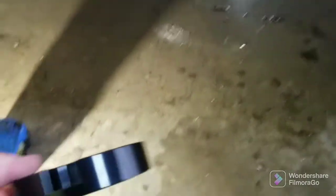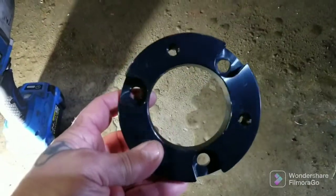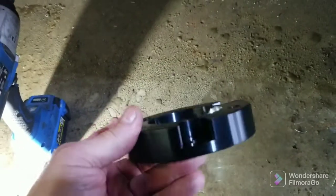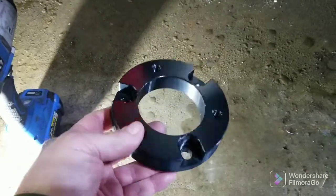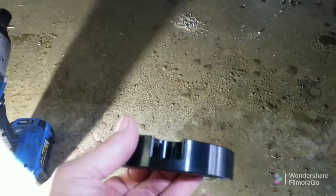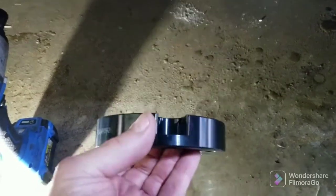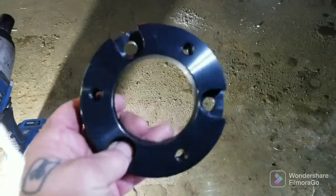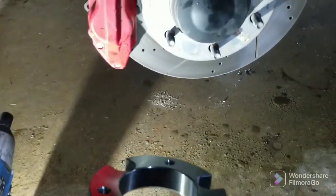While I'm not a big fan, a small one like this that gives you two inches for level, I'm okay with that. It's an inch and a quarter spacer. I would not go any taller than that personally. If this was a hardcore off-roader, I would get height adjustable struts and not do spacers, but this will be for mild wheeling, mild overlanding.